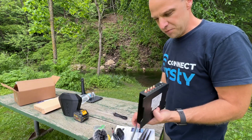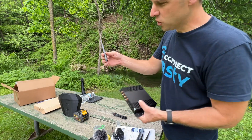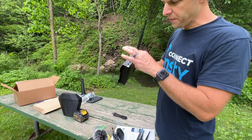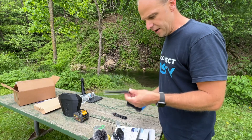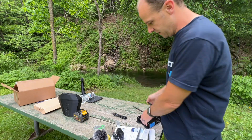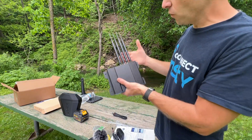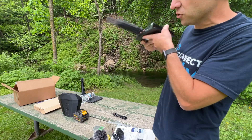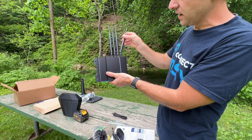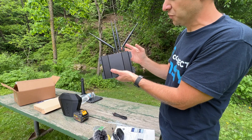The system can actually take 12 to 36 volts of power. We're going to be putting the antennas on the router. You'll notice you have a 2.4 and a 5 GHz antenna connection. If the antenna says 2.4, match it up to 2.4 on the back. The others may say 5 or 5.8G — you can put those on the 5 GHz connector on the back. When using the router, you're going to want to keep your antennas in a vertical position. You don't want to store it flat because then the waves will go up and down. Instead, you want them to go out, and I recommend you put a little bit of space between the antennas.